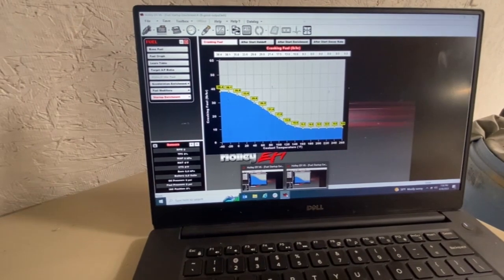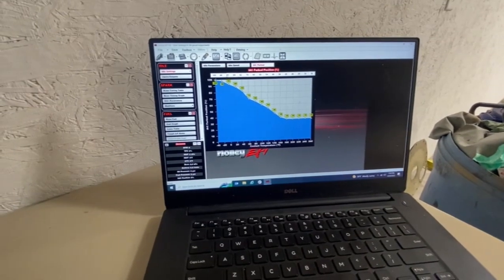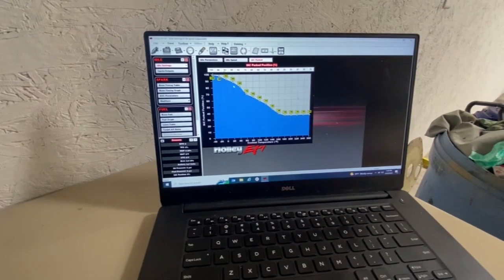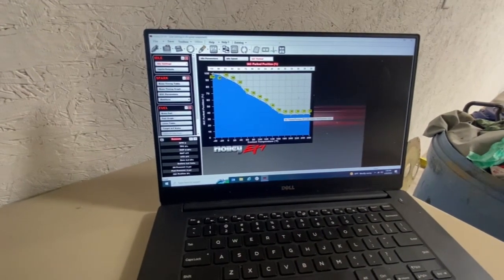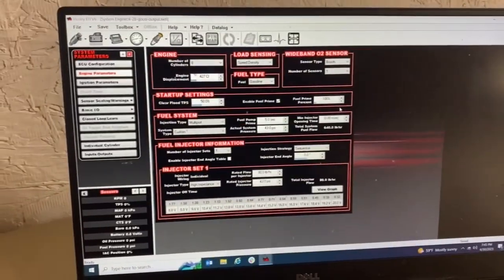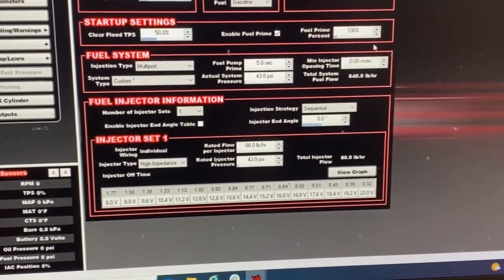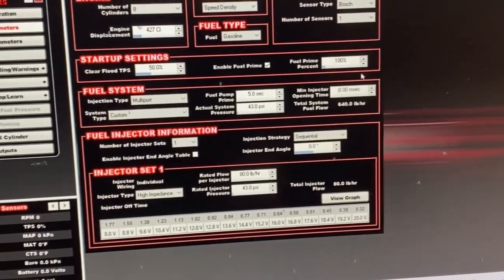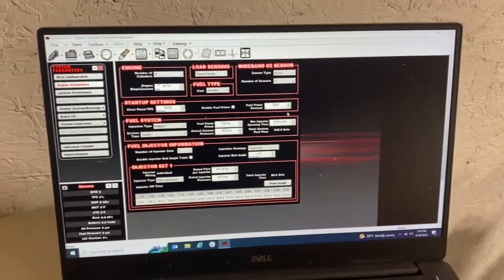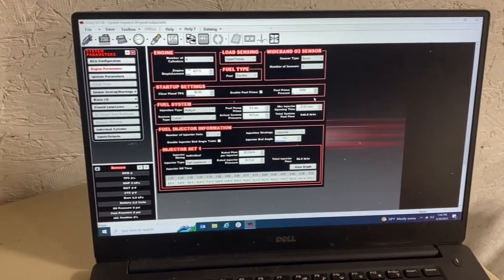So just for comparison — there's the new one, and here's the old one. I did come back and trim up my IAC parked position values. I'm not saying these are 100% where they should be, but they're closer than they were. The fuel pump prime was the other area I said we'd work on. The new tune ended up at 100. The old tune was 200 — I don't know why, it just was. This is working for me, not that it will work for anyone else.